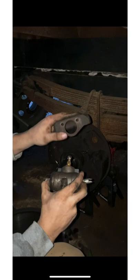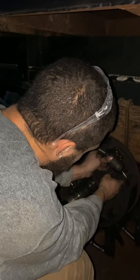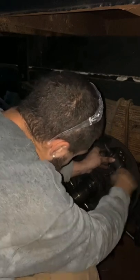Whenever I was cleaning up, I realized that I forgot this big piece, which is the dirt housing for the wheel cylinder. I don't think that it needs to be there, but it is supposed to be there. I just missed it when I was putting things back together, of course, when I'm doing a tutorial. So as you look at the rest of this, just think, man, I can't believe he didn't put that on. I'm sure you would have anyways. For whatever reason, it did not cross my mind. So again, put on this little shield to keep dirt from possibly getting into your rubbers and stuff. I didn't go back and put it on, but if I have a problem in the future, I know what it is. Sit this right down in here, and then push it down there.